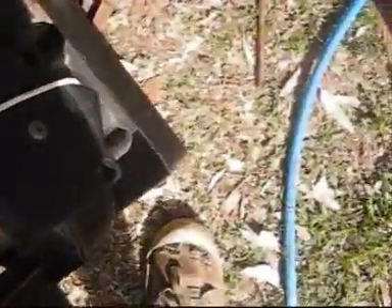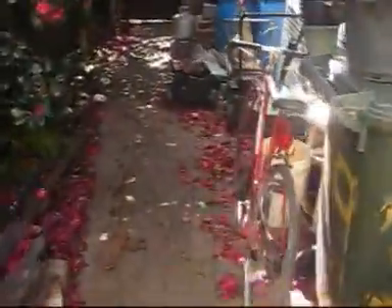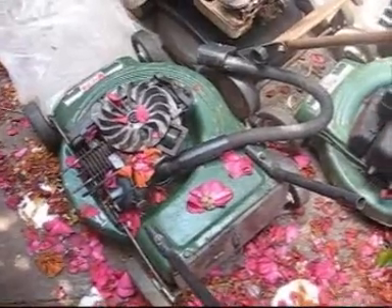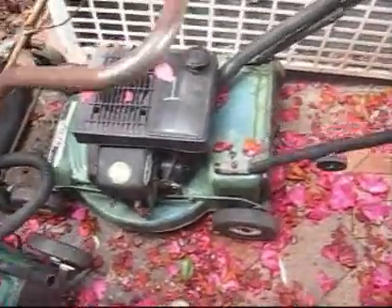I've replaced the pull cord on this motor, which is on that blue base, and this one's going to have a toggle switch — I just want to see how well that sells. I painted the muffler in black paint. I'm going to be reconditioning the cylinder head for that two-stroke and also one down here. Both of those have bad heads — they're warped — and I put new gaskets and that still didn't fix it. But this one here should go; I had it going. That one needs a new diaphragm.